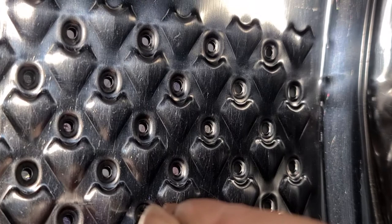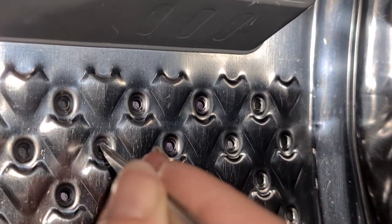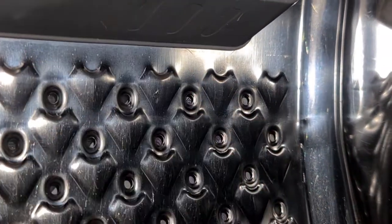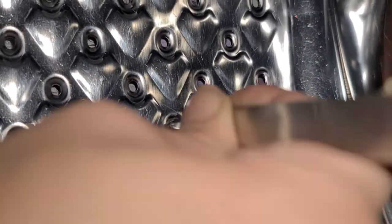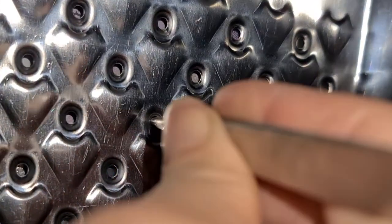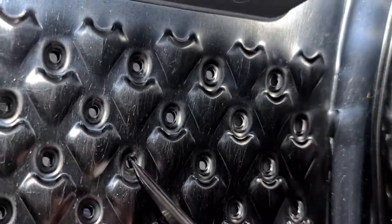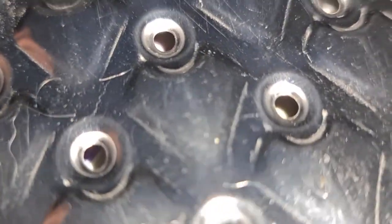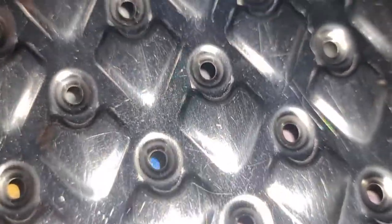There's something sparkly in there — got my tweezers. I do think the tweezers are better than the wire, but whatever you can use, whatever you've got, just poke it in there. You can't do any damage — you're just putting metal into a metal hole and there's a plastic back on there. You can actually see the note moving down as I poke that. You can see the note starting to move down and I'm just teasing it down and down through the holes, bringing it right down to the bottom of the drum.